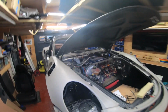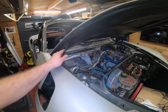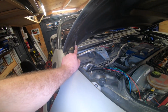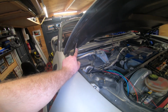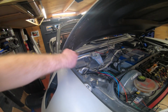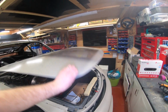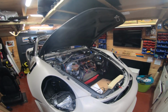And the gas rams that come from the 987 Boxster are just not strong enough. All you need to do is replace your Boxster 987 gas rams with Boxster 986 ones. The 986 bonnet was a lot heavier, and the gas rams that came for it were a lot more powerful. So just do that. They're exactly the same size, just more powerful. So that's what we do there, and that enables the bonnet to stay open. Otherwise, it's going to bang your head.